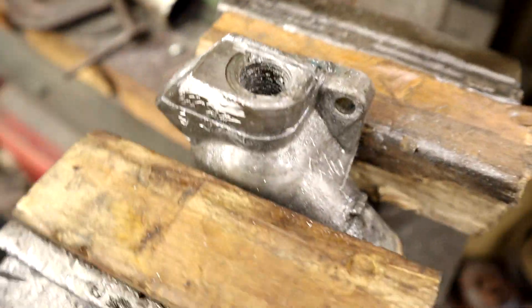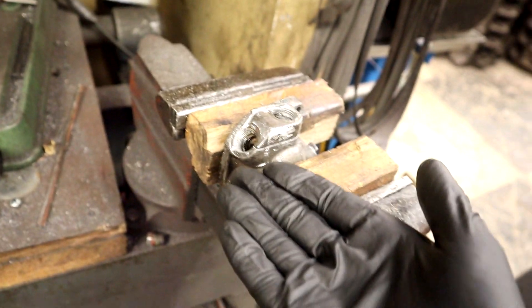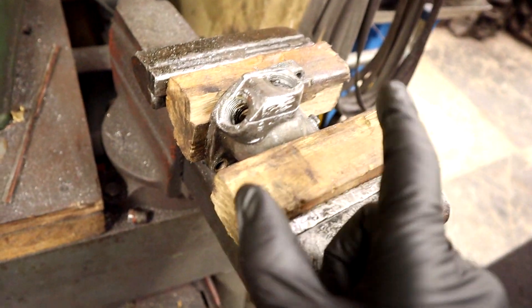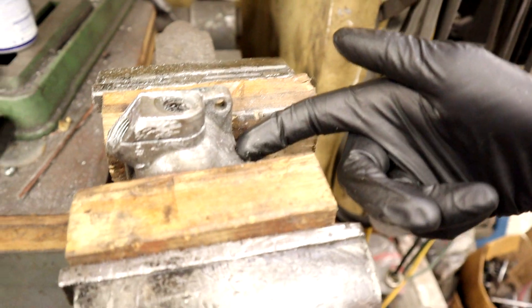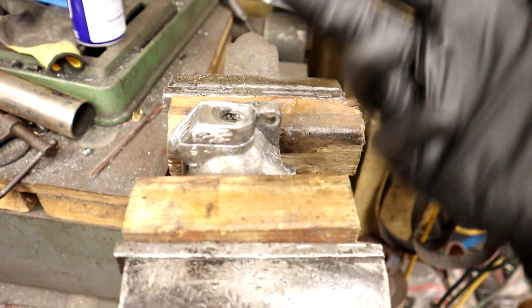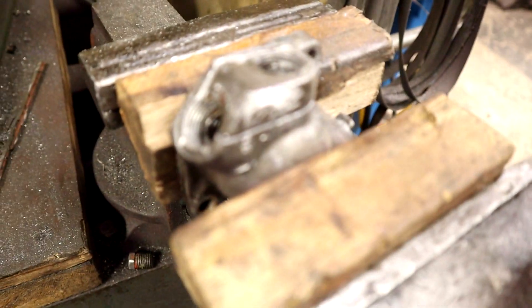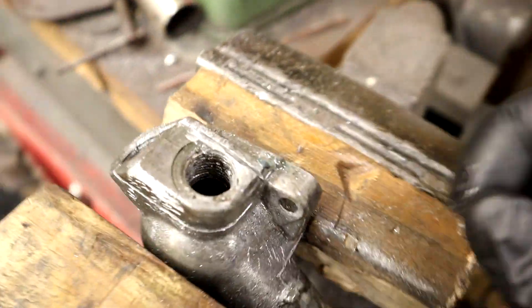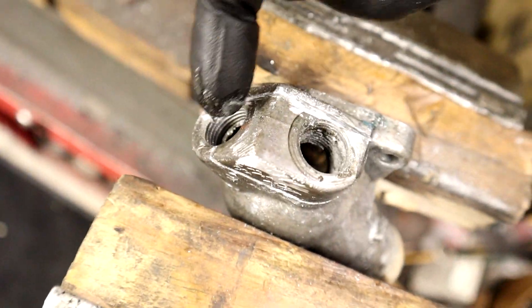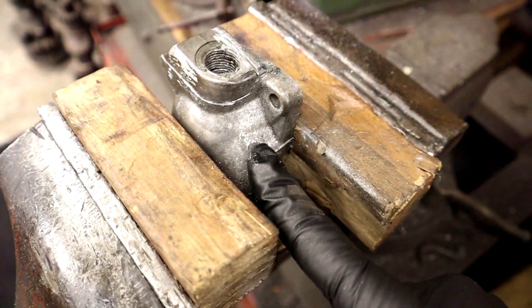I just realized I'm like halfway through this project and I haven't even shown you what I'm doing — I need to film my entire life! So this is a thermostat housing off of a 7MGE, and there is one less port for a sensor. Since I'm going standalone, I definitely don't need any of these. What I'm doing is cutting off this portion and having the amazing Danny weld up the holes, then smooth it out and make my own really nice thermostat housing with stuff I already have.